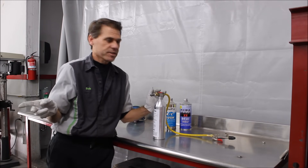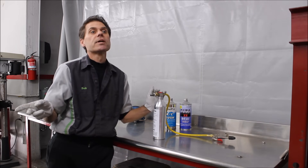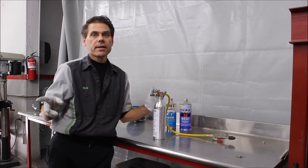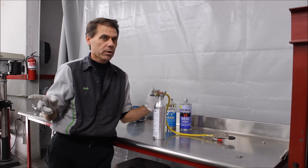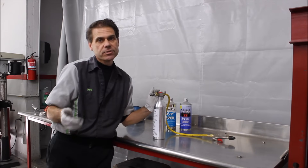So let's go over to this car. I have a 1971 Olds Cutlass here where the system has been open for years, and we are just going to go ahead and flush out the evaporator core to remove old oil before we install the new valves onto it. So let's go to the car.